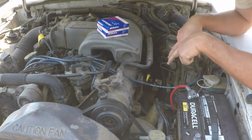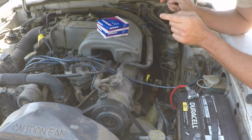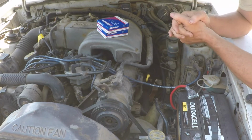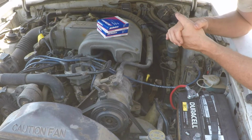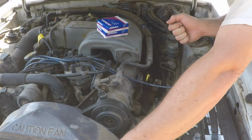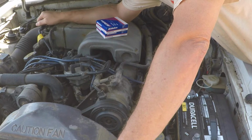Now, one of the things that we have been sort of dragging our feet on with the pale horse here has been changing the spark plugs. And this can be summed up with a simple misunderstanding amongst 50% of the ranch denizens that it requires removing the upper intake manifold. However, the other 50% correctly pointed out that no, the only thing that's a problem is the heater, coolant, air breather for the exhaust emissions equipment. That's the big thing.